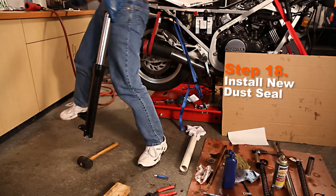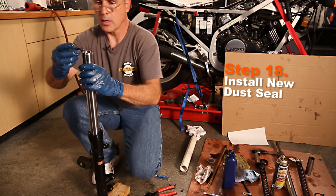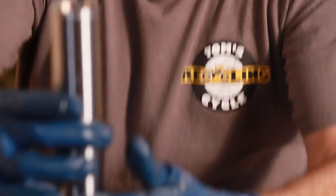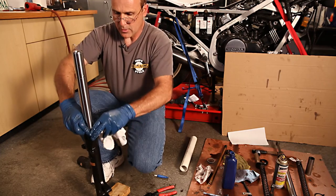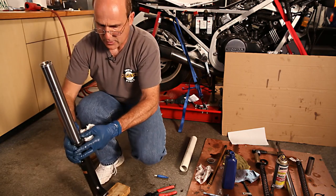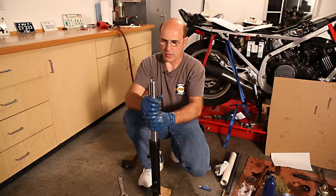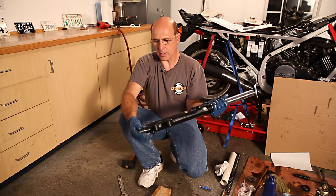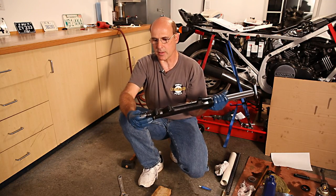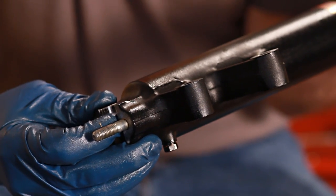Let's listen — it's in. Now I can slip one of the new boots over this. Flip the boot down and get it on there nice and snug. The allen bolt is snug at the bottom but hasn't been torqued yet. Normally you want to torque this to the specified torque. If you want the threadlocker to work properly, let it dry overnight, then add your fork oil.